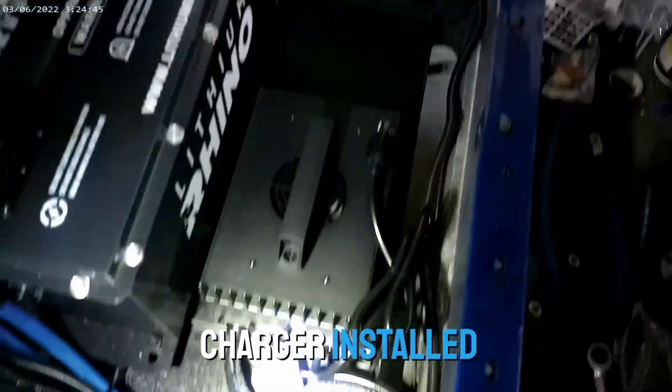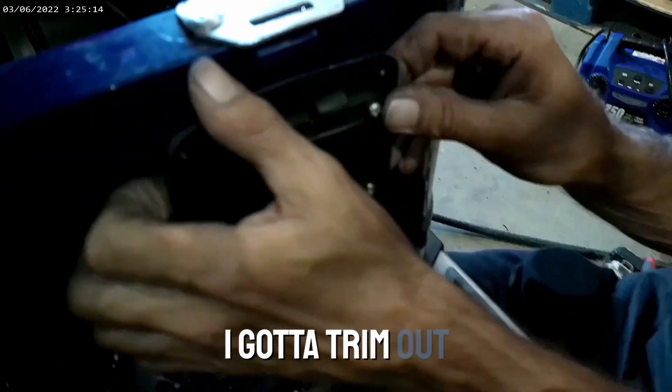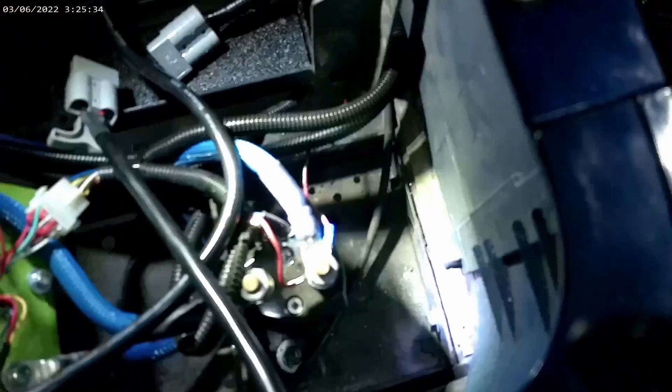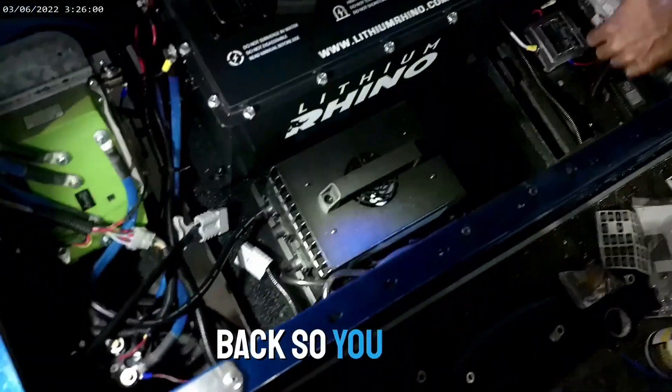So we've got the battery in — we'll wire it up and now we're going to get this charger installed. We have the two wires coming off the battery — they go to this plug, which just plugs into here. On the AC side, what we like to do is install the charger on board so you can just plug in an extension cord. Eric over here has an adapter plate that we made. That's going to go in right there with an AC port, and then this will just plug into the back of the AC port. All you've got to do is plug an extension cord in. On the reed switch wire for this cart, the solenoid was perfectly right here for the battery, so we're almost done.